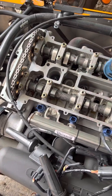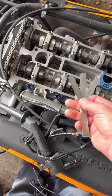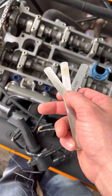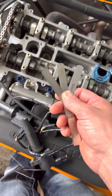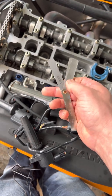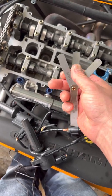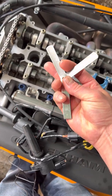I've already confirmed the gauge sizes — I'm not going to repeat that because I've only got one hand free. We've got gauges here: 0.15, 0.07, and 0.06mm. We're going to combine 0.15 and 0.06 to give us a combined thickness of 0.21mm for this measurement.